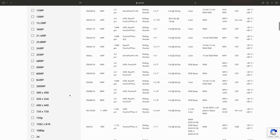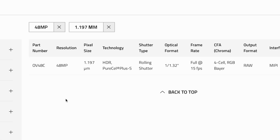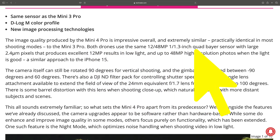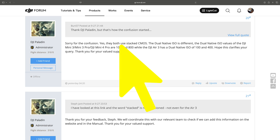Could this be the sensor? Well, it sure looks like it. Just for kicks, I go to Omnivision's product page — they've got a great search tool. I click on a couple of filters to narrow it down, and yeah, there's really only one that matches the specs and it's the same one. So remember, we're talking about the Mini 3 Pro here as per the DP Review article, and they're saying it already has a stacked sensor — so it's certainly not new. I did some more poking around, read articles, watched reviews, and many are suggesting the Mini 3 Pro and Mini 4 Pro use the same sensor. Further to that, admins in the DJI forums have confirmed that the Air 3 and the Mini 4 Pro use the same sensor.